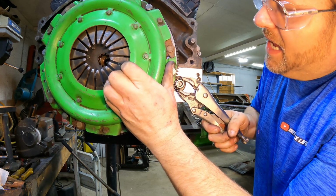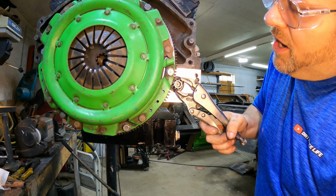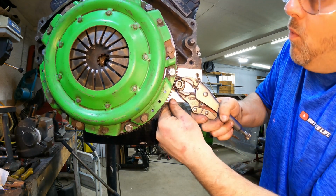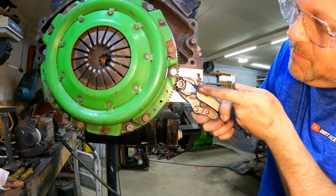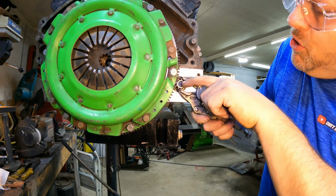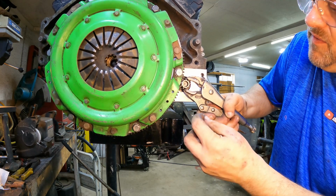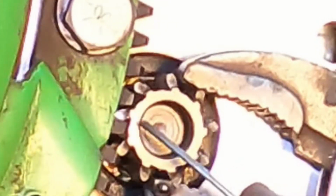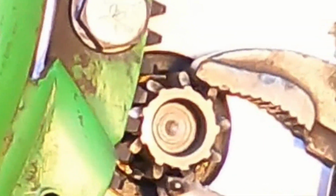All right, so now I'm in the gear, okay? Now when I'm in the gear, I'm gonna pull this gear all the way one way, with one of the teeth straight timed into the middle there. The gear here is pushing against one of the teeth down. So I'm twisting up on this and pulling back with these vice grips, so I've created as much gap as I possibly could on that other tooth. In other words, I'm fully contacting on this lower part right here because I'm twisting up with this.